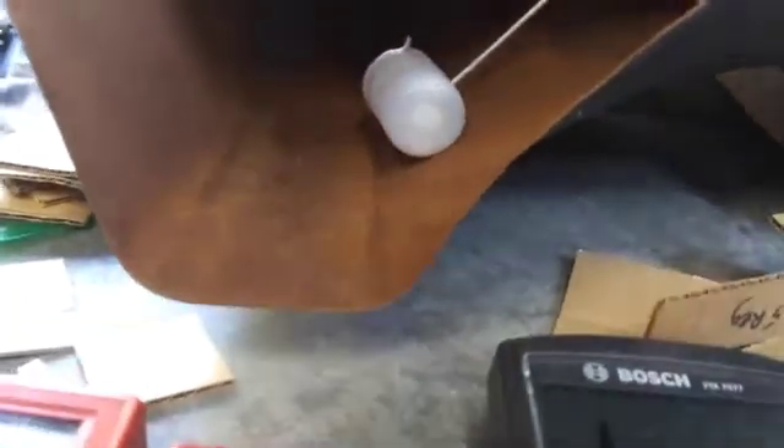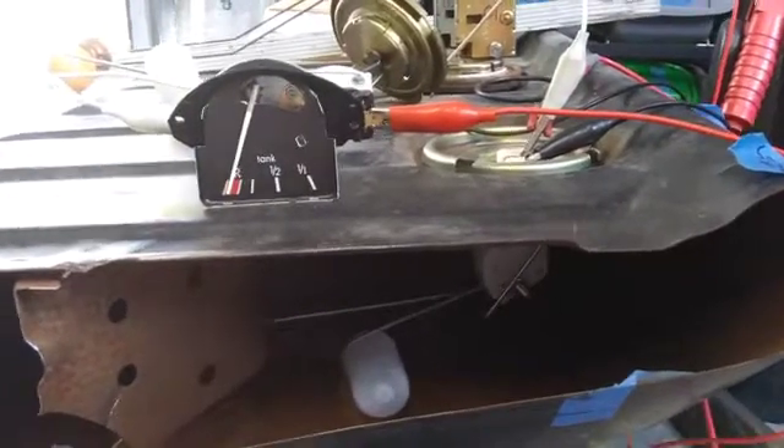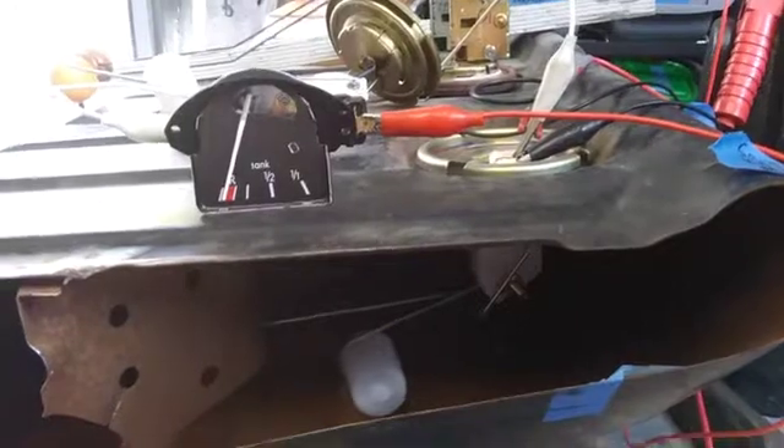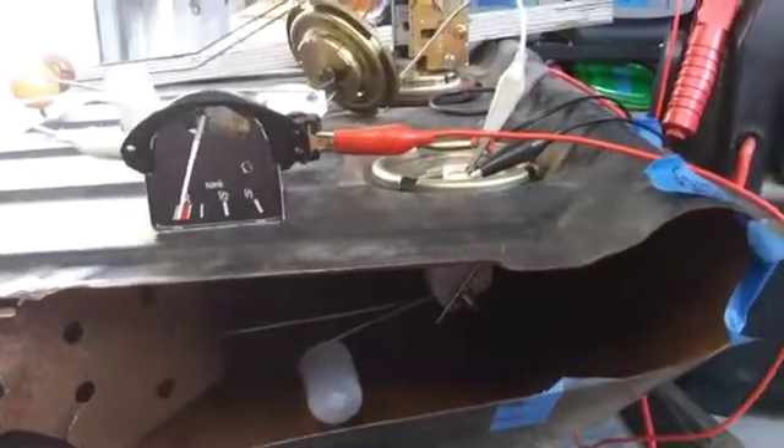Okay, we've got it in the empty position. Notice that the arm doesn't go quite all the way down, but that's only about a pint of fuel left in the tank at most. It seems that this sender does not drag — as tight as you can make it, it still won't drag. At empty, we're reading just a little bit to the plus of the empty mark, maybe about one millimeter. I measured the resistance and it was about 66 ohms, so that's going to be okay.